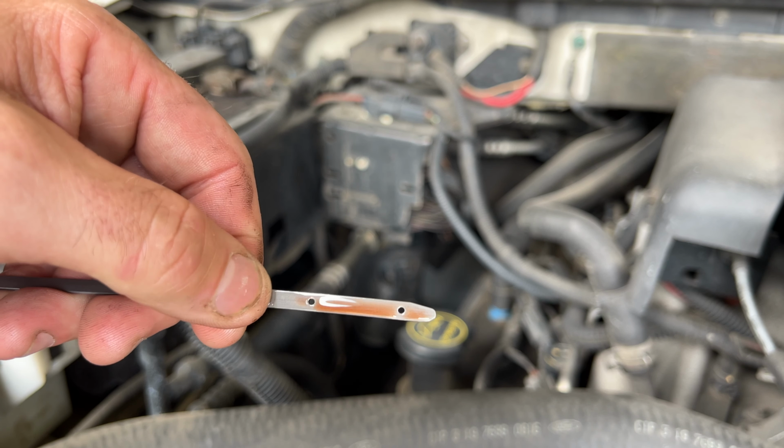So if you guys are going to do this job, you'll probably want to get 6 quarts, one 5-quart jug, and then 1 quart of the Motorcraft, which I'll put a link in the description for as well. And again, this was a 2003 Ford F-150. Went ahead and replaced the transmission fluid along with the filter.